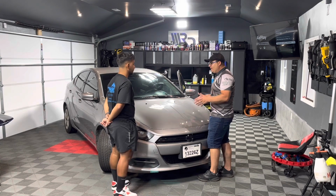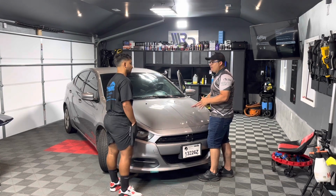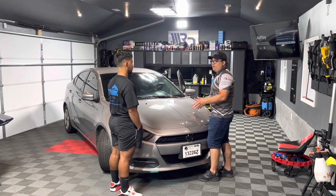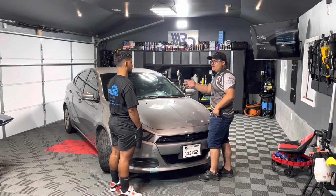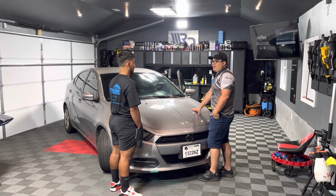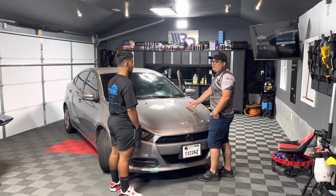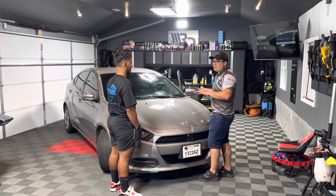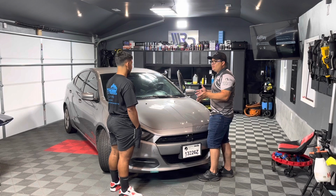But if they understand, you show them what you can do and how far you can go. If the car has a lot of scratches and they say, I want my car to be perfect, but you've got only like 3.9 mils on the paint, what are you gonna do? Let them know. I can't do it. This is what we got, and this is what I can do for you. It always goes back to talking to the customer.